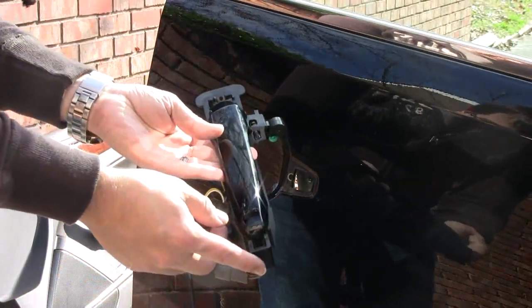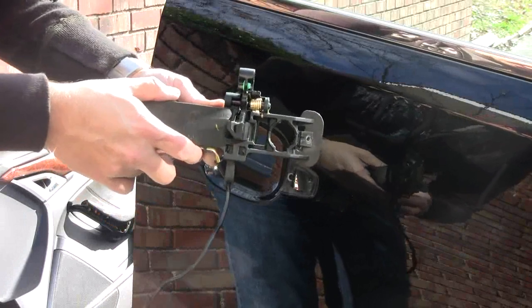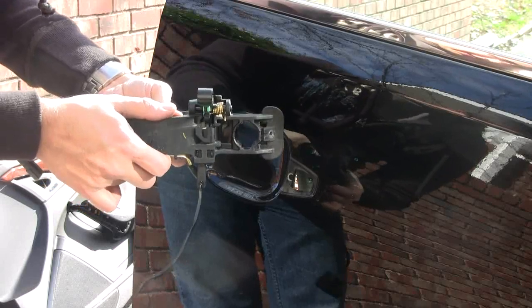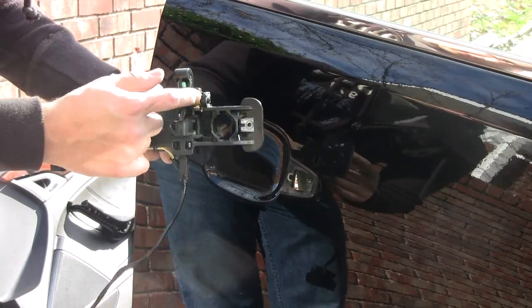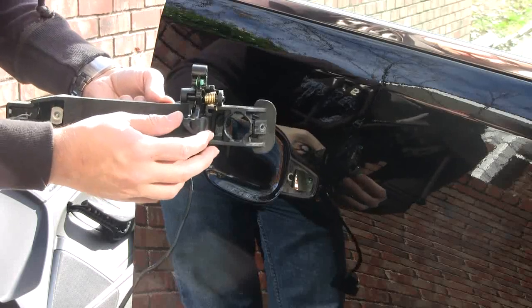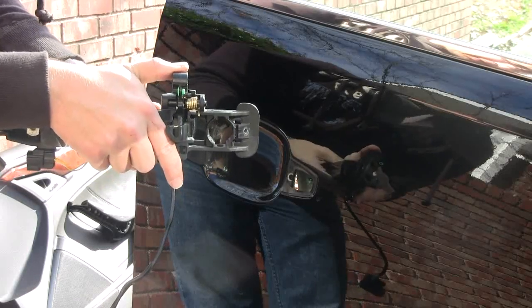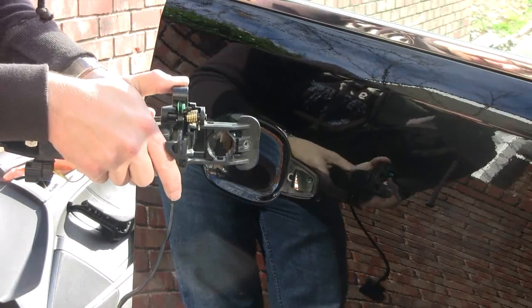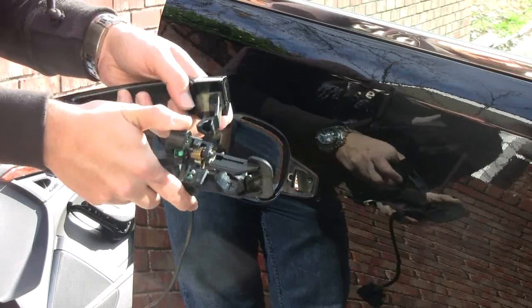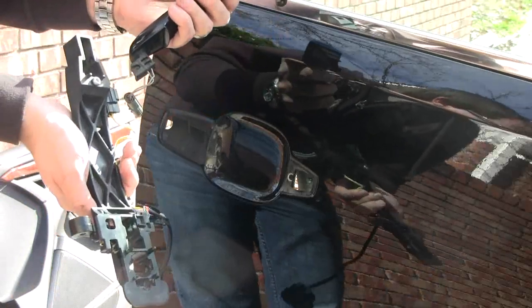What I've done here is reassembled the outer handle on the old housing to give you an idea of how this functions inside the door, since it would be hard to shoot from inside. When you pull on it, you can see this counterweight on a spring, which is what makes the door handle retract back into the door. To release it, just push this back from the inside of the door a little bit, which loosens up the handle — the handle actually slides this way. If you do that just right, you're able to get it out and the door handle comes out.